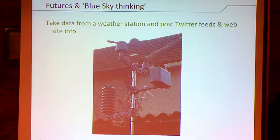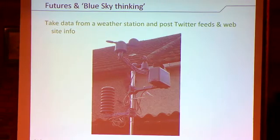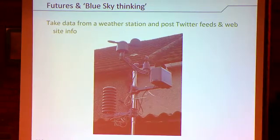It's one of my favorites as well. Or put a weather station outside your building, your data center, your house if you care, and take that data. Now you're thinking, no, this is real-time data. This is real-time data that you have presented to your system, your Raspberry Pi in this case, that can be put onto your Nagios system. Say, yep, today, 6 feet away, it's raining. Now you don't get a better weather forecast than that, do you really? But it's just an example of these things that aren't intended to do that particular work, but they present an interface that you can provide into the Raspberry Pi. And once you've got that programmatic ability, why not use it?